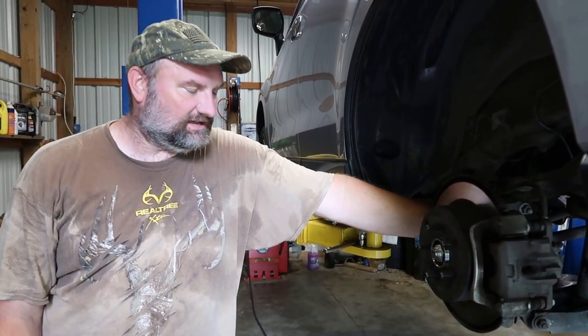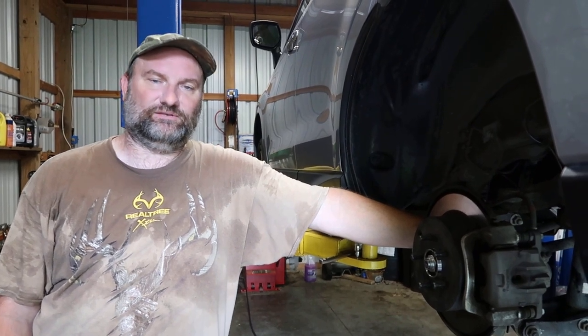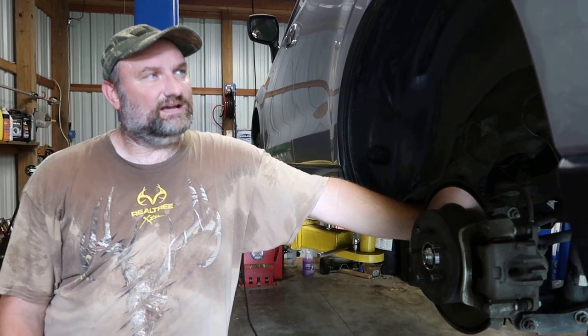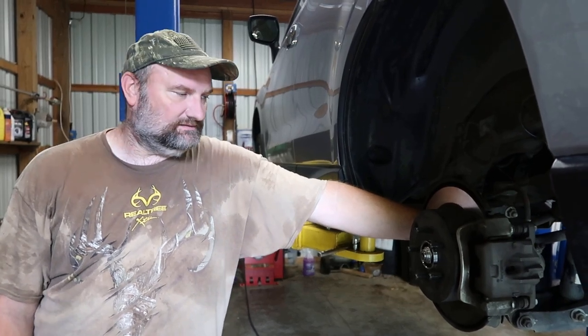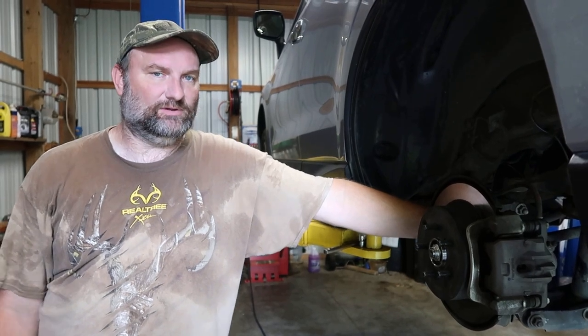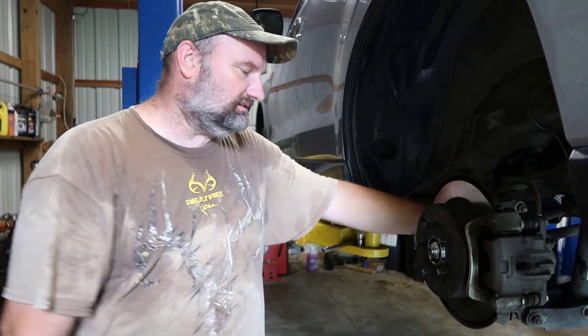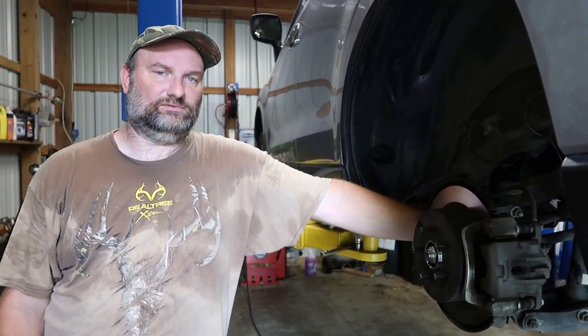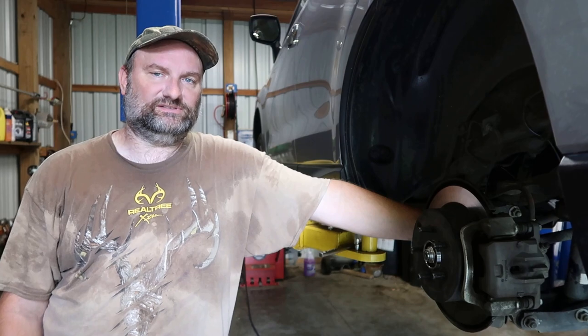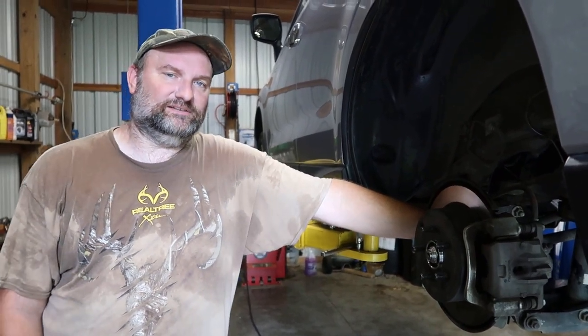Got this bearing on and it didn't take that long — probably took me twice as long just because I was recording and showing y'all how I did it. Normally this job takes maybe 25-30 minutes if I wasn't recording, just to show you how quick you can actually do this bearing on this car. The Subaru just turned over 51,000 miles, so it went out pretty early as far as I'm concerned. They've had a lot of problems with these — I've noticed on YouTube people having replaced them and everything. It's an easy job, pretty much anybody can do it. The main thing is whenever you torque that nut down, make sure you torque it down to the proper spec to be sure you get that preload on your bearing set right — that's more important than anything. Appreciate y'all coming along, hope y'all enjoyed the video, and as always, friends, from my family to yours, y'all have a blessed day. We'll see you later. Bye-bye.